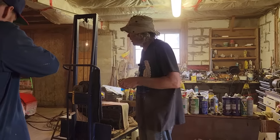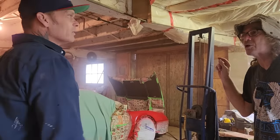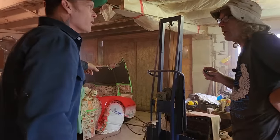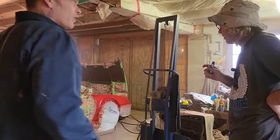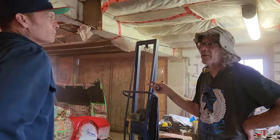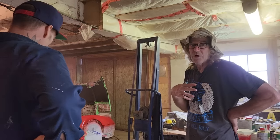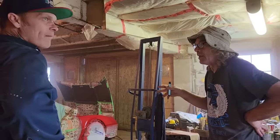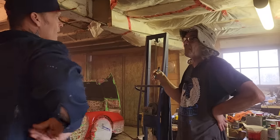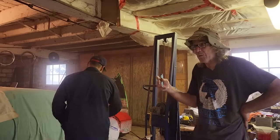So basically, in my opinion, several dry coats on that fender until those fish eyes are filled in. Yes, that's probably what I would do. And then you can lay a nice wet one on, because it's not that thick that you're getting any amount of texture. You're not getting textured right now. Usually if you put it on thin and dry, it goes orange peely. But it isn't. It's just going on dry. The paint's mixed plenty wet, so that's a good thing. But the bad thing is the fish eyes. So if we put enough paint on there dry, maybe it'll work whatever's causing the fish eye out of its existence so that it'll cover over, and when we want to go shiny, it'll accept it.